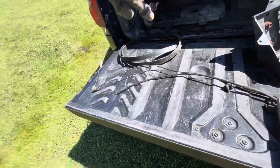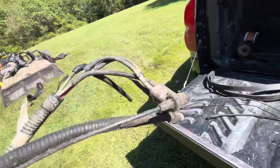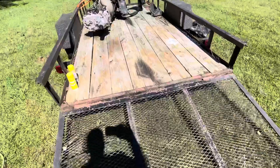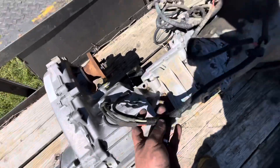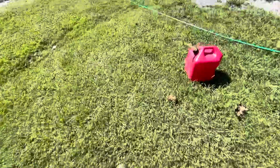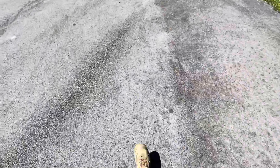So this is kind of the whole vacuum setup — that's what hooks into your transfer case. It runs a little bit of everything on both engines; it just hooks to a different spot when you do the diesel swap — it hooks into the back of the intake. On the V10 it also hooks into the back of the intake, but on the diesel you've got to run all your vacuum lines off of that vacuum pump, so it's a different location. Try to find the harness if you can. You can probably make them custom if needed.